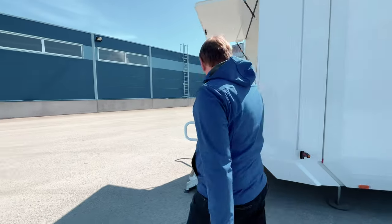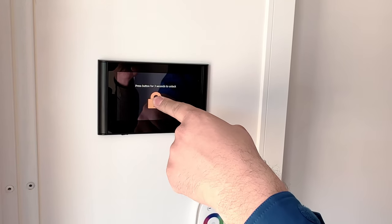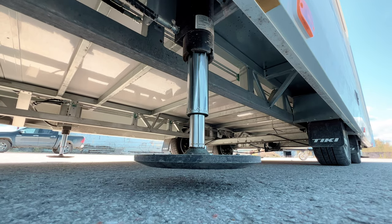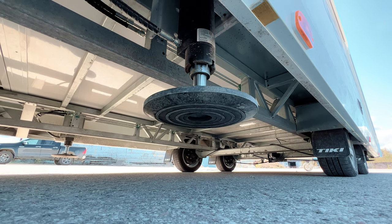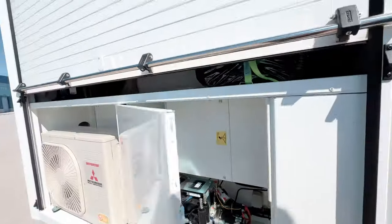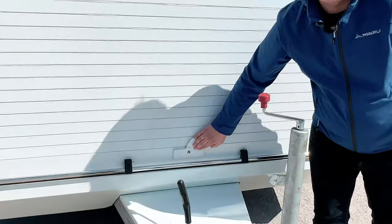Now we go to the back. Go back inside and — if you're using the fixed remote — press continue, go to leveling, and push 'store.' This will lift up the hydraulic legs. When the system is finished you'll hear it stop. Then use the kill switch to disconnect the 12-volt battery. Close the storage compartment and pull the latch down. You can lock it with the lock hidden beneath the cover so no dirt gets inside.